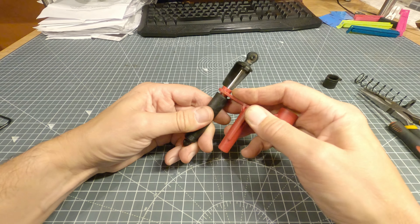For a spacer to reduce it by about 4mm, I used some spacers from Tamiya shocks — they always give you these bits and bobs. You just need to find something you can thread onto there to reduce the stroke of the damper. It could be a bit of tubing — just needs to be resilient enough to withstand a lot of movement. Put that onto there, then put the piston top back on with the washer facing downward, then put the nut on top. That's how you do it.